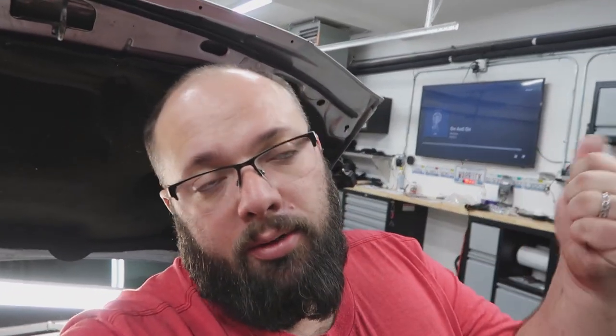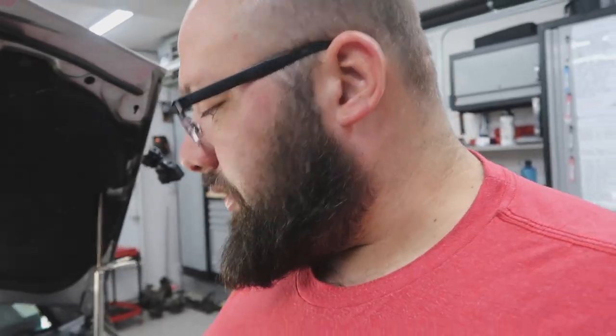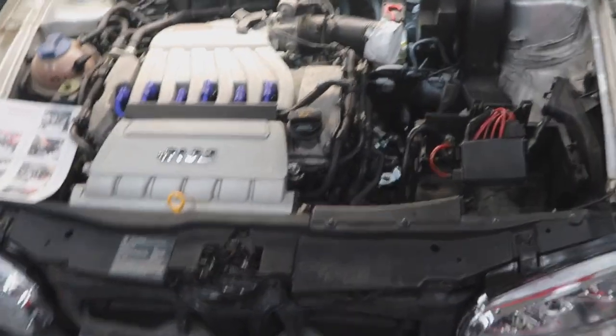Two things. Instructions on HPA Short Shift don't say you need a puller. You probably don't, but it's much easier with a puller. They don't say you need grease, but they recommend greasing it, so get some grease. So it's a pretty self-explanatory job. Now my shifting will give me 40% quicker shifting. If I can shift 40% quicker, great. I've only driven this car 20 to 40 miles, so I won't notice a difference. I'll just really think it's normal. But anyways, that project's done.